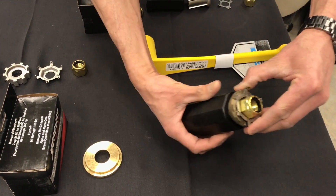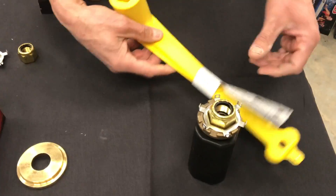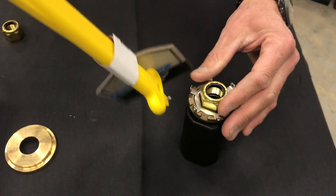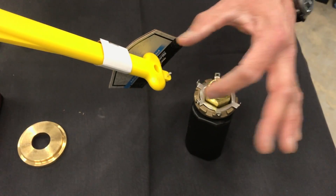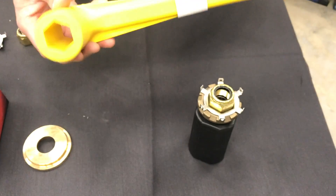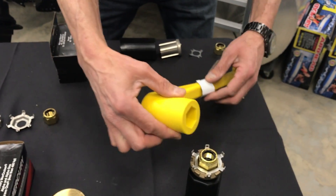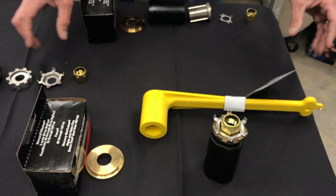This is the first generation or the old style of the Mercury hub kit, which I really like because the prop wrench fits nicely into the grooves and also fits the tabs on the side that you lock down — every other one. So this prop wrench is kind of an all-you-need tool because it unlocks the tabs and it actually torques your nut up onto your prop shaft.